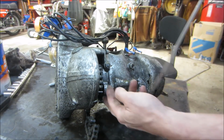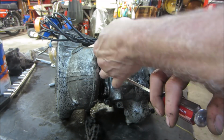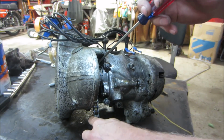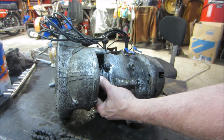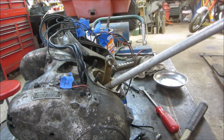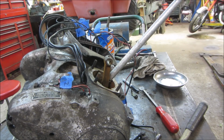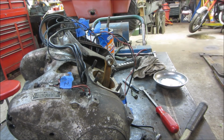So if you can walk that chain out of there too, now that it's accessible. Of course, the crank won't turn, so you can't shift it out of gear. It's stuck in gear, so the chain is kind of stuck. There. Move it around without that slapping in the way anymore. That gasket's off. Let's hit it with an air gun, see what kind of crap blows out of there. Whoa, that did not look good. Wherever there's rust, it had to come off of something, right?